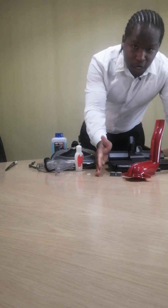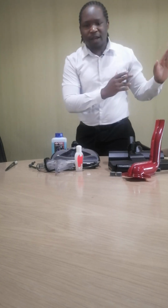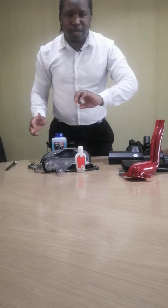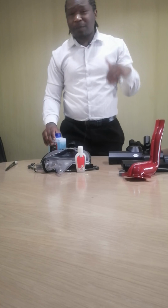I'm going to be doing the normal regular vacuuming that I do every day, just to vacuum and extract dust, and it's going to go into the water and I'll throw it away. And here, I don't need these. If I'm using these, I don't need these. I'm not going to be putting water as a filtration. This means on the bottom gray tank there's going to be water and chemicals, and on the top tank there's going to be nothing. I'm going to start throwing water into the spraying water, and I'm going to extract that water, and it's going to go to the top tank. I'm not filtering dust, I'm washing stains.